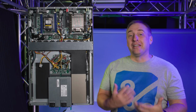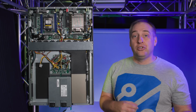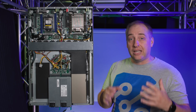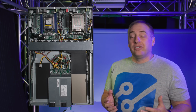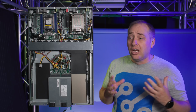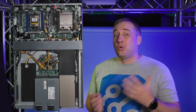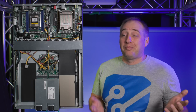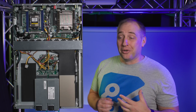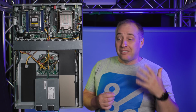And I kind of get it, right? Because there are definitely organizations out there that want a 1 CPU to 1 GPU ratio. They may use those lower power and lower core count CPUs just to keep the cost in line. And maybe they don't necessarily need 8 channels of memory with an 8-core, 16-core CPU. So I could totally see why that works. The other way to look at it is if you have a 16-core 4-channel memory CPU, in a lot of ways, that's better than having a 16-core consumer CPU where you only have 2 memory channels, right?